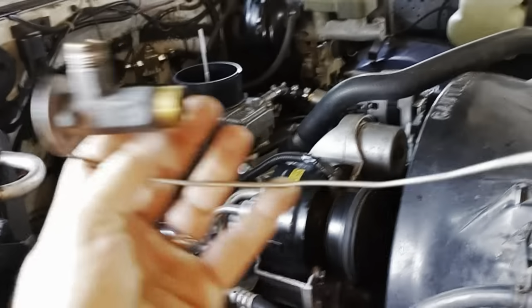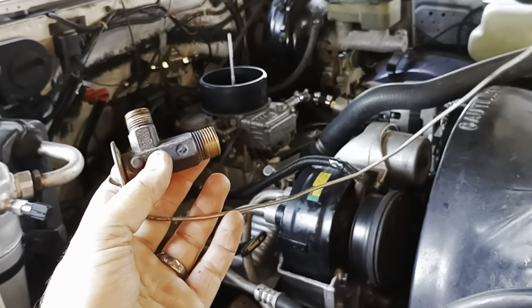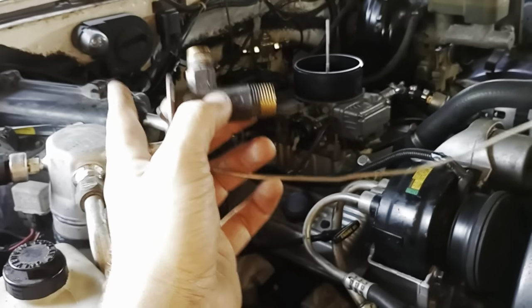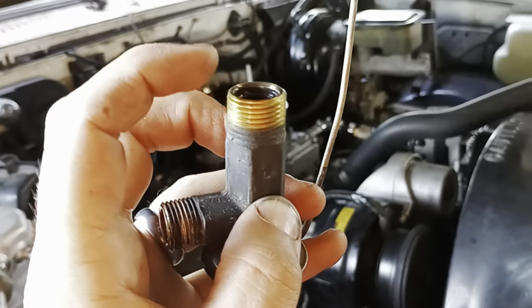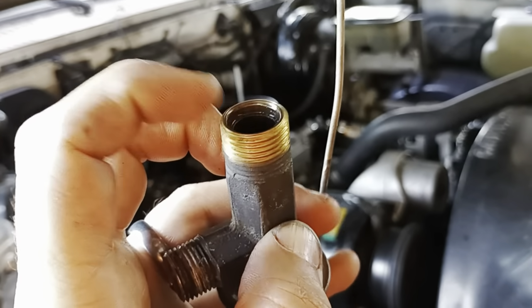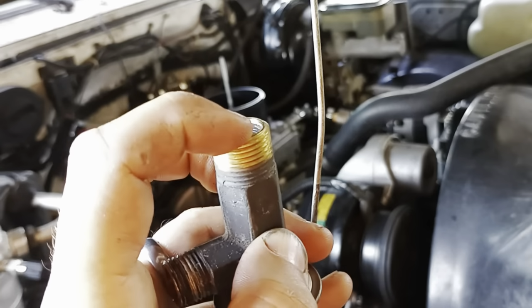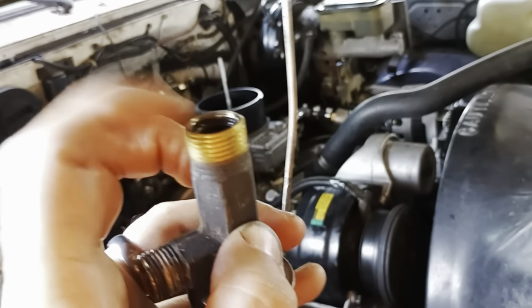That is your switch for the back. I forget what they call it on Rock Auto, but this thing controls the evaporator coil in the back. And right here on this side, if y'all do this on yours, an O-ring goes inside of this, but there's a brass shim that goes on top of this. When I took this thing apart, it all looked like one piece, and I put the new one in without that shim, and it kept leaking.